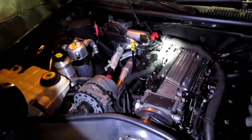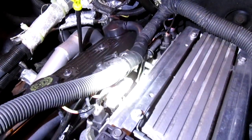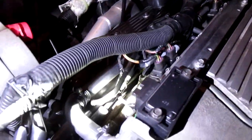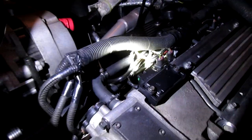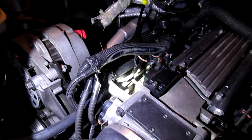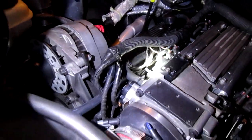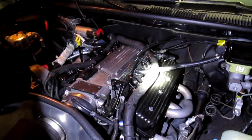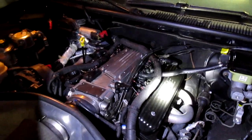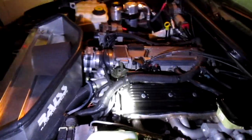There's two on that side: HVAC vacuum and the fuel pressure regulator. You got your EVAP — big fat thing — and it goes into the throttle body on the other side. And the fresh air. Then on this side is the EGR feed. If you still have an EGR valve — my EGR valve breaks, that is going bye-bye. And that's the only thing it's got.